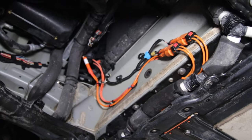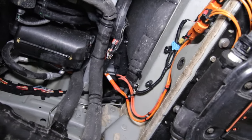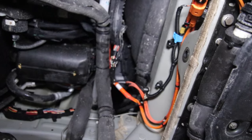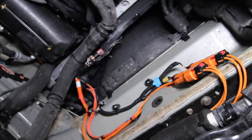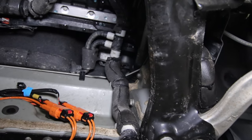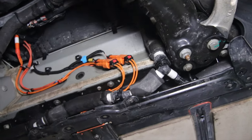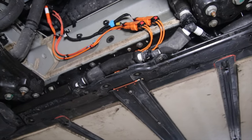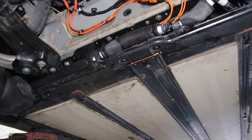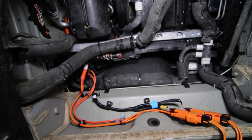The car is designed to try to warm up the battery to about 30 degrees Celsius as you're driving. But I guess the assumption is that that happens quickly. It actually doesn't. With my testing, I found that it only heats up approximately 0.1 degree per kilometer. And that's with a fully insulated car. Wow. So for most cars, you could drive quite a long time and really not gain too much heat. The only way you can heat the battery up relatively quickly is by using that battery preconditioning mode.